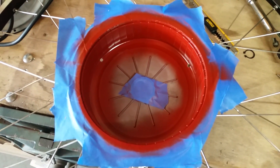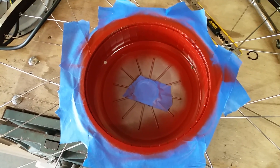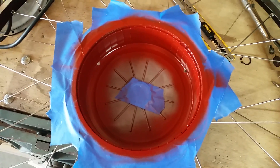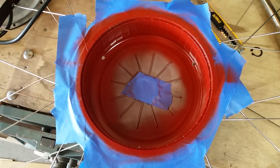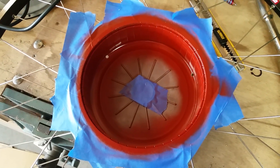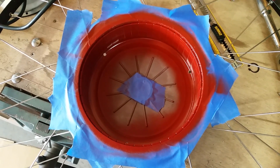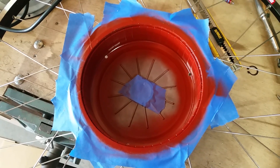The reason we do that is we want to give the water a path out. Water is going to get into the motor — and actually even if we do have the weep holes, water will get into the motor; there's really no good way to avoid it. Justin at ebikes.ca had an extensive video about water damage in motors and has more to say on that. But the bottom line is that water is going to get into the motor, and so we want to give it a path out.